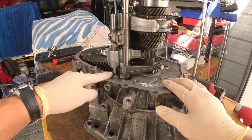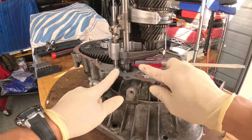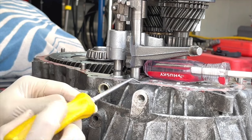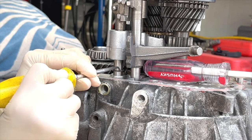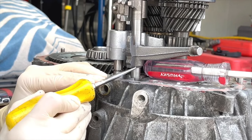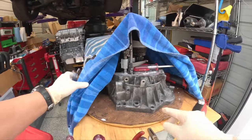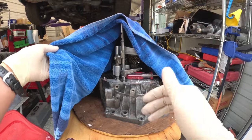Now we need to remove the spring clips — there's one here and another one underneath. I'm going to lift the reverse shift fork up a little bit and place a screwdriver in here for better access to the spring clip underneath. Here's the reverse shift fork lifted with the screwdriver. If you look closely, there is a spring clip right here and another one right here. To grant access to these, we're going to rotate this around like that so you can see the ends of it. I'll do the same with the second one in the back. Now with the spring clips oriented properly, I'm going to take this beach towel and put it around my whole working area. The idea is that when we pop these guys out, we want those spring clips to stay within the blanket — because when you pop that thing off and it goes flying, it's going to turn into a Jesus clip.